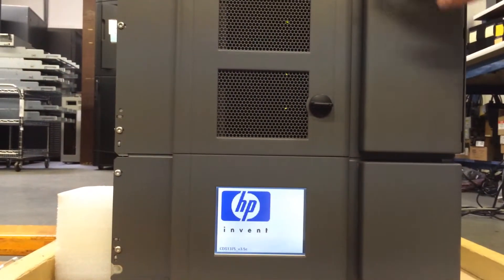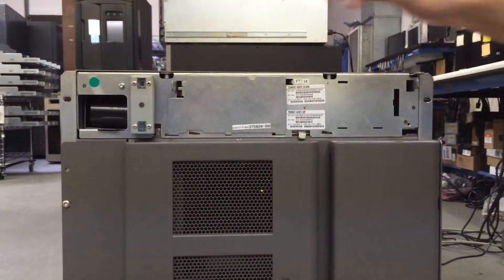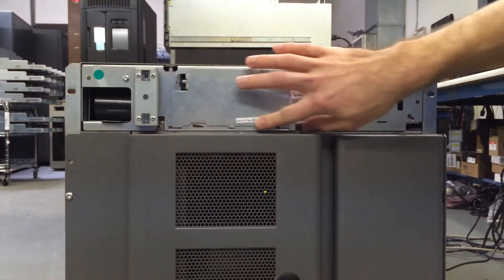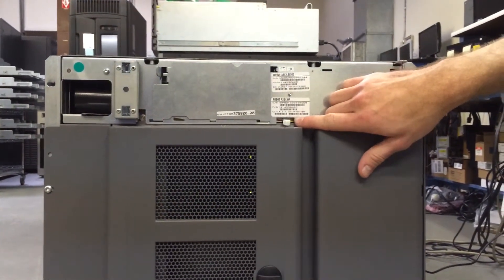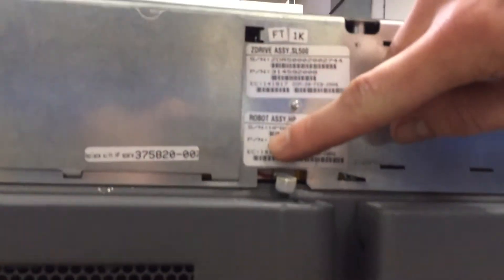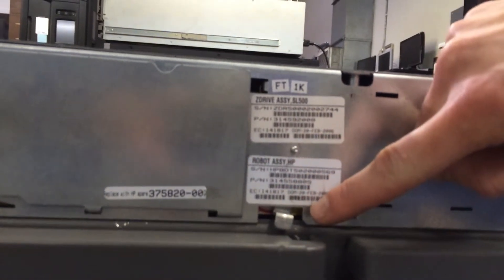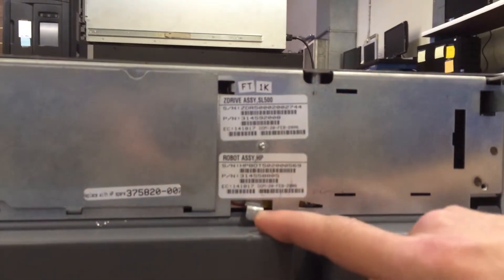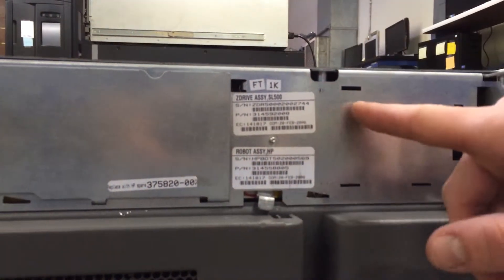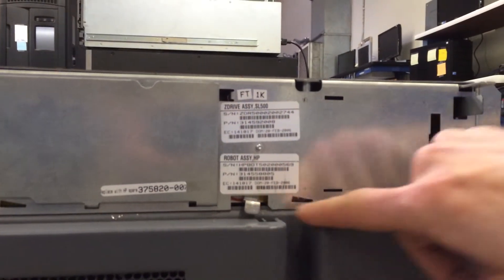It's going to take some time for it to get ready to initialize, but we should be able to see movement of the picker. I want to focus on the face part of the picker — very important. Make sure it sits nice and tight, make sure the door is in proper position. This little mechanism I talked about before — once it's all the way to the left position, it means the picker is in the home position. And once the picker starts moving, this little notch moves to the right, which prevents you from opening the door. Once the picker is inside it should be on the left; once the picker starts going up and down, this mechanism will move to the right.